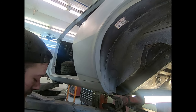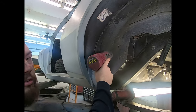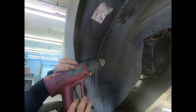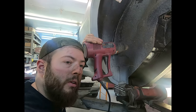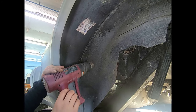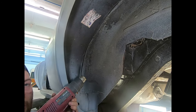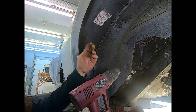We have a heat gun, and we're going to heat it up and soften it. This will take you probably a couple minutes. Just heat up a section at a time and blast over it with the wire wheel. The wire wheel is on the table over there. And I just heat it up to where it's obviously really toasty, but it'll eventually start being soft